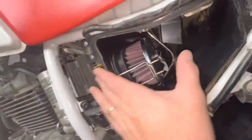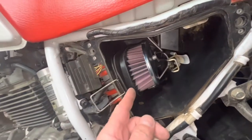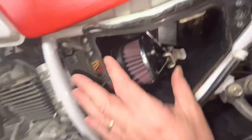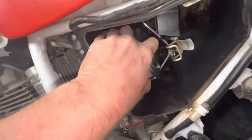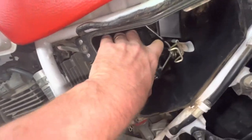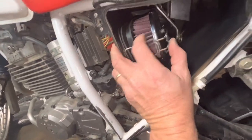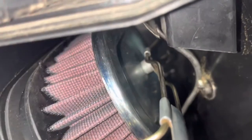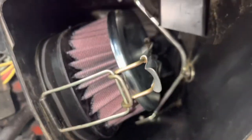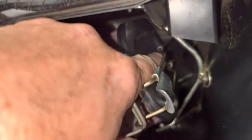Taking it on and off is really easy — that's off, pop that one out. To put the new one in, that circle has got to sit right on there, and you need to make sure it's sitting nice and flush. Then it just hooks in right there. You know you've got proper insertion and proper alignment when that circle is right in the indentation of the filter.